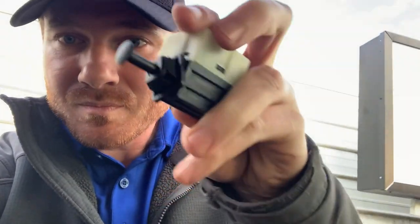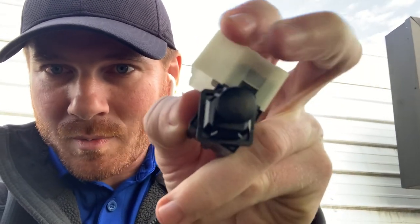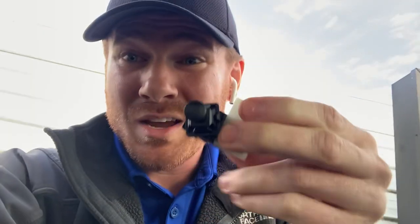You're going to see that there's a keyway on the top here. There's a little notch on the very top right where my finger is, and there is a corresponding notch right where my thumb is on the top. This notch is going to fit right around that — pop it in and it's going to click. You can plug it in before you install it. You're going to have to push down the brake pedal a little bit to give you the space to get that in, and then you should be good to go.